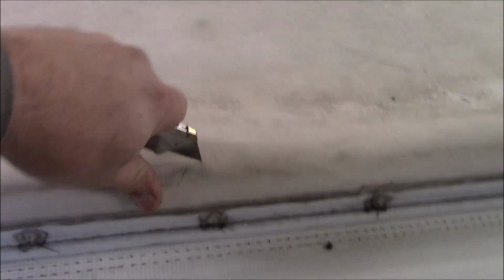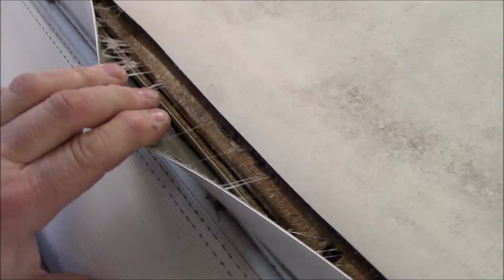Now I don't even know if they put any protection under here, but it doesn't look like it's compromised. But this is a pretty thick and heavy roof system. But there's no curbs, so you pretty much got the same problem with them, right? So there's no protection here. And you really need to put a buffer piece in there, but they didn't do that. So obviously we're going to strip this. I'm guessing the decking would be okay.